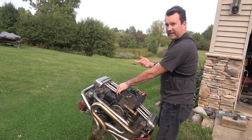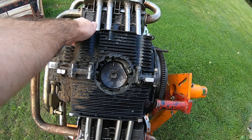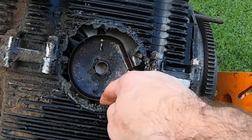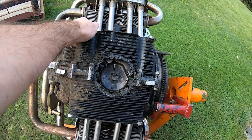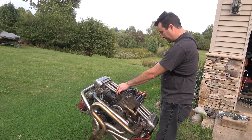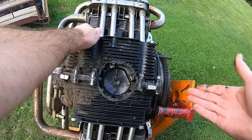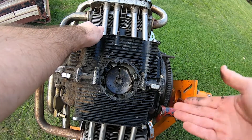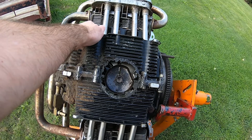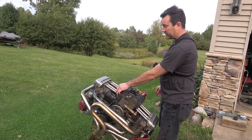Good thing I had that long stinger on there. This is what happens when you decide to set your sand rail down on the engine. I think there is a little bit of water rot in here too — that happened when it was sitting. Sometimes these carbs and stingers will allow a little bit of water in and it winds up in the oil sump and things get brittle. Brian was saying he actually lost one of his rear tires and the sand rail sat down on the asphalt he was driving on and all the oil came out — I guess that's a quick way to do an oil change.